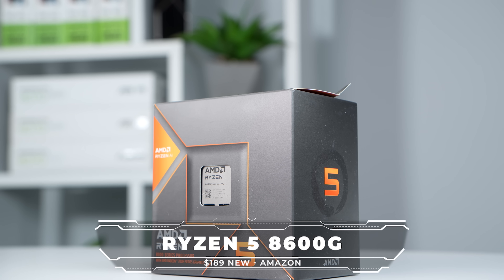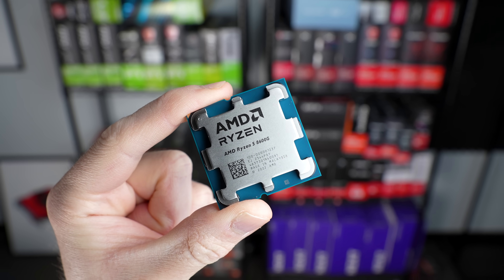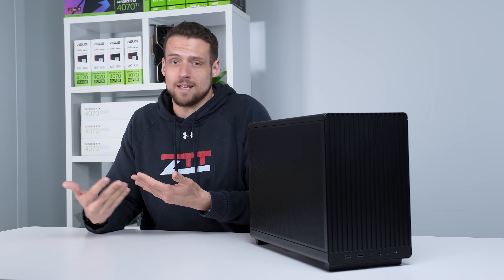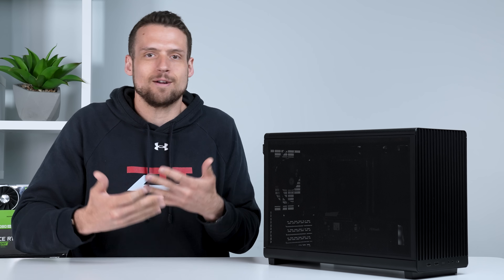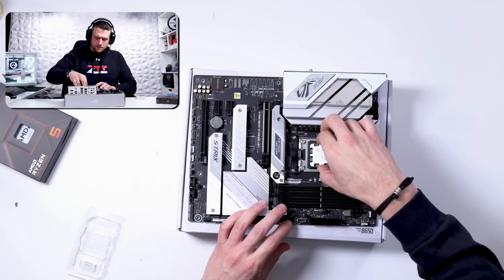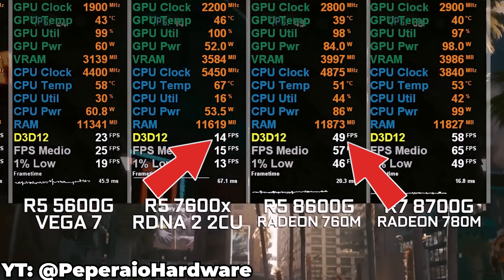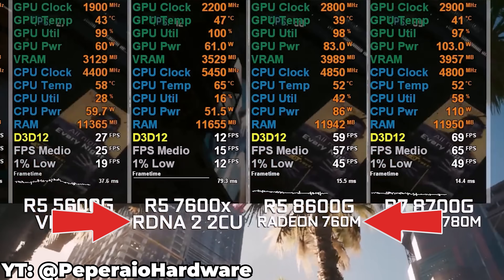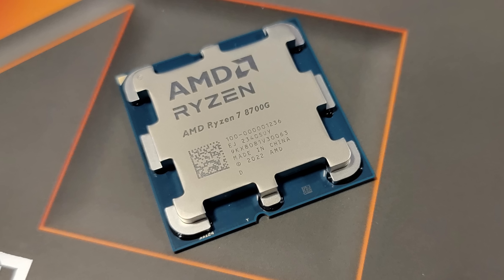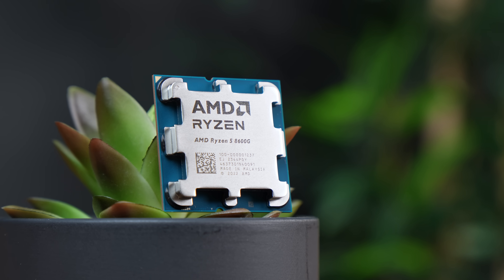Starting with the CPU — which is actually the GPU as well in this case — it's the Ryzen 5 8600G. It's technically an APU because of the integrated graphics, but unfortunately this is still one of the top options in 2025. Some of the new AM5 CPUs like the Ryzen 5 7600X now include integrated graphics, but the iGPU in there isn't nearly as powerful — it has a two compute unit RDNA 2 base GPU, whereas the 8600G has a Radeon 760M with eight compute units based on RDNA 3. As of early to mid 2025, the Ryzen 7 8700G and Ryzen 5 8600G are still the two top options for CPUs with integrated graphics, just like all of last year.